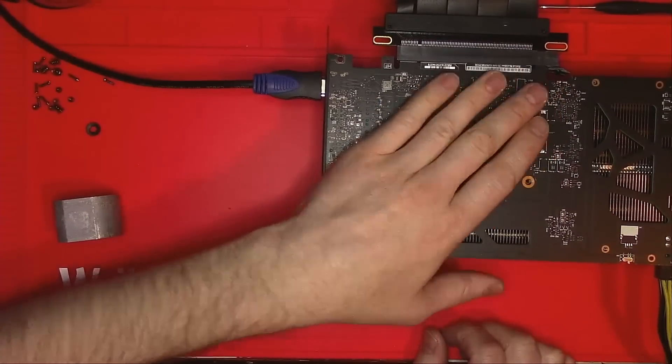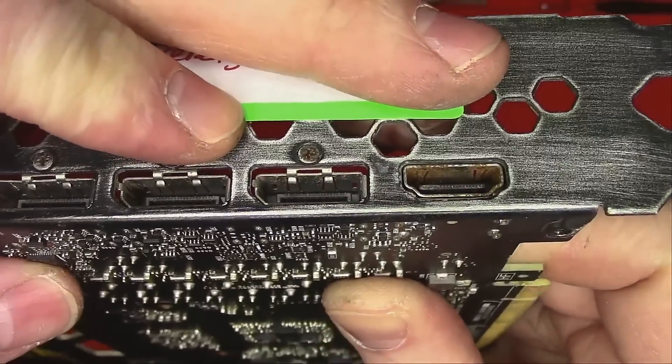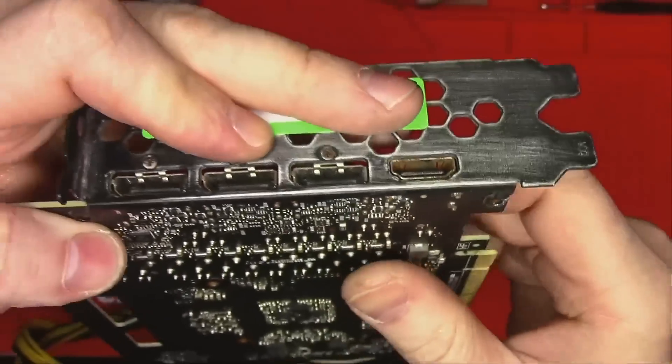As you can see, the image is frozen and no new images are coming out. And if we take a look at the HDMI pins, we can see rust. Let's do a light touch-up and see if that helps.